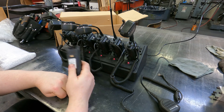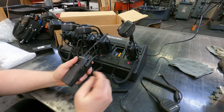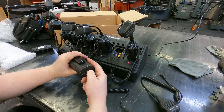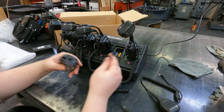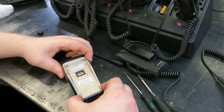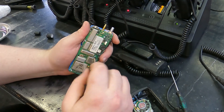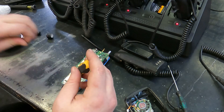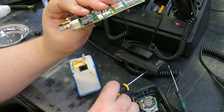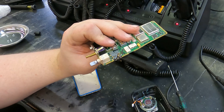If you're having a problem with these radios turning off randomly, it's usually the battery — replace the battery and that problem goes away. The second common issue is when you have a mic attached and it gets kicked; that breaks the connector on the inside. It doesn't really break the connector so much as a small solder joint. You disassemble it using Torx screws, and there's a solder joint right here that always breaks. When the connector gets pressed, it pops off, and you have to re-solder it to get the mic working again.